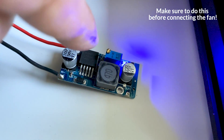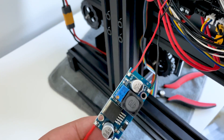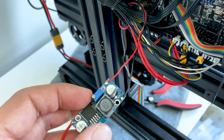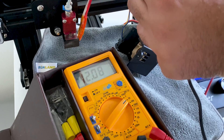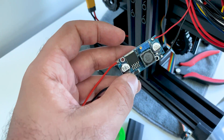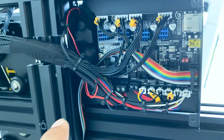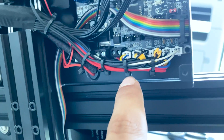So we've got our converter wired in. We now have to adjust the actual voltage output to 12 volts using this dial. We have it all wired up now. We can see on the outside we have it connected straight to the wires coming out of the motherboard area. We've attached two cables here for wiring to the motherboard, and we've also double-checked our screw to make sure we're outputting 12 volts. Mine, when it came from Amazon, was outputting about 20 volts, so I had to open this up maybe four or five turns to get it down to 12. We're going to put a little piece of shrink tube on there and put it right here in the motherboard area. It's all nicely wire managed, and there is the converter — the cables coming in going to the output, and the power cables coming down into the corresponding output.